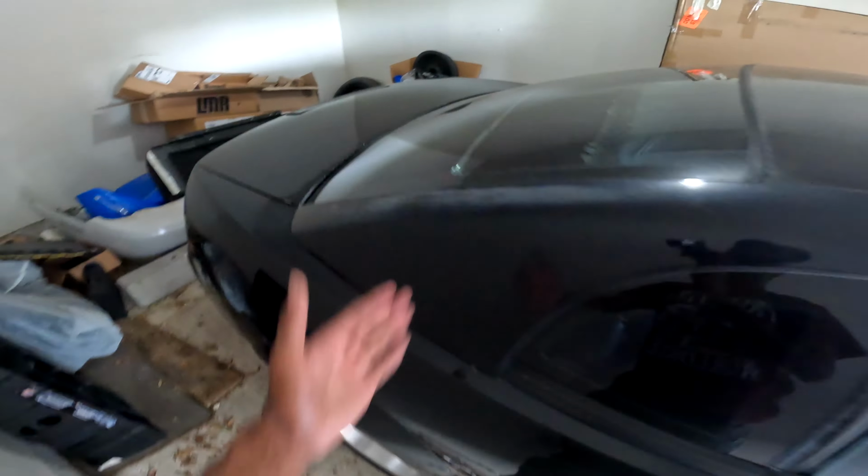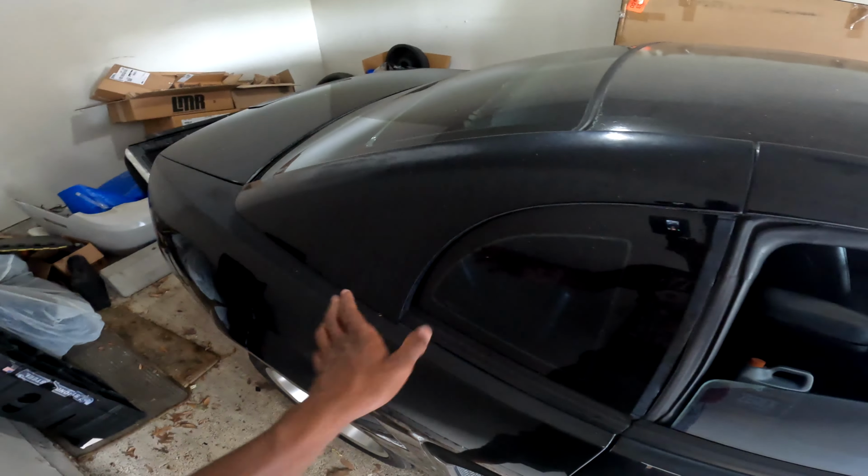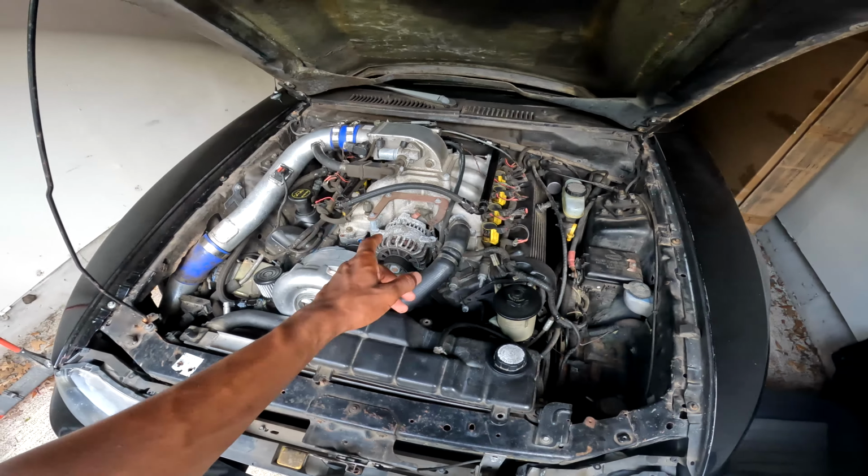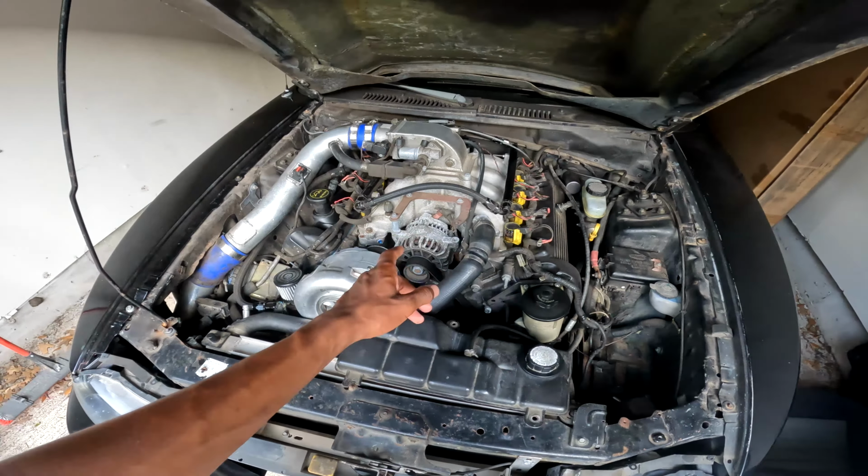Now, if you guys follow me over here, if you can see it, we do have a fuel filter back here, and this is a sump tank. Now, we have an external Holley pump, which is done. Burned up, done. Fuel pump does not prime, does not work, so we're definitely just going to go ahead and get it towed, push it out of the garage, take it to the shop. Could be a loose ground, could be a bad pump. Most likely a bad pump. I'm going to go ahead and get that swapped out for a different solution, because the Holley pump is probably causing all these problems I'm having.